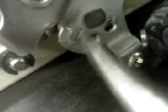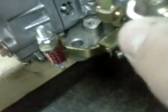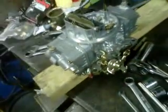And finally, one of the most important aspects is the pump cam and squirter nozzle system, or whatever you want to call it. Accelerator pump, I don't know, whatever. So you have 2 slots, and I believe 2 allows in more air, and slot number 1 puts in more fuel. You adjust this lever arm here, so the second you crack this throttle, it's moving that arm, or else you're going to be opening the throttle blades and not putting any fuel into it.